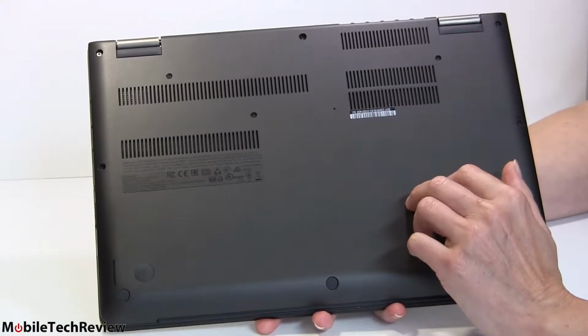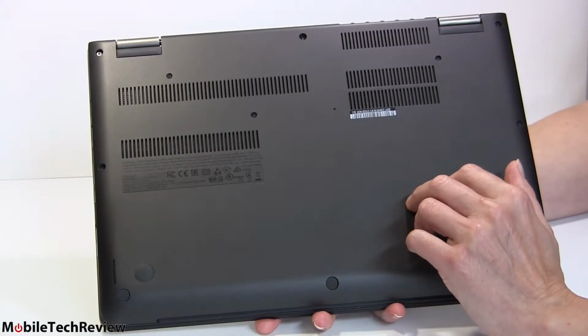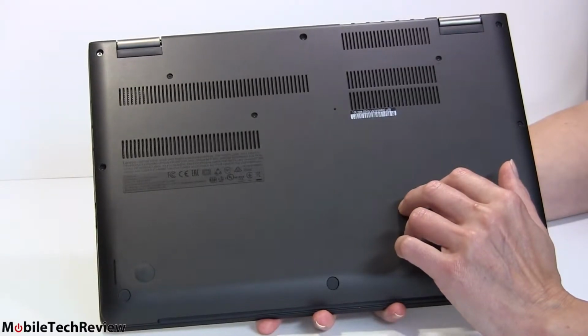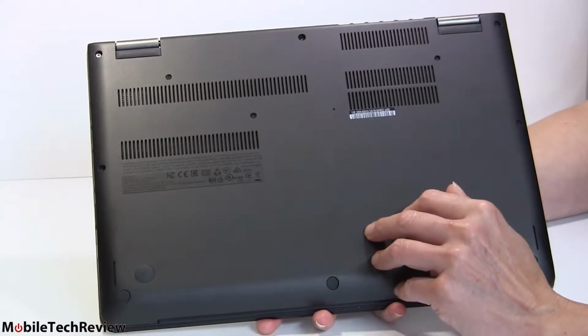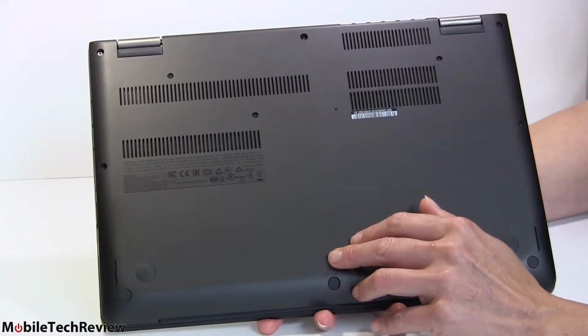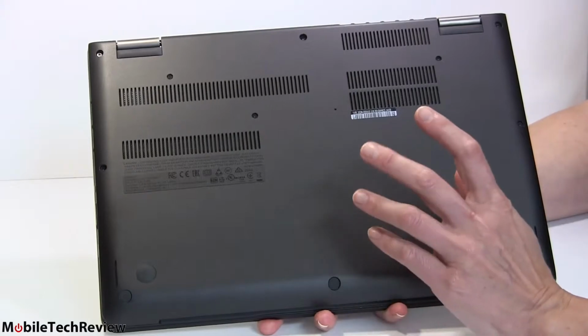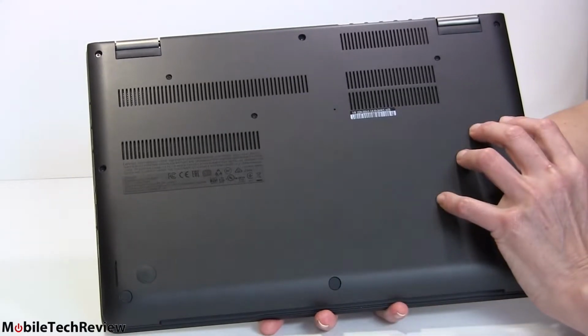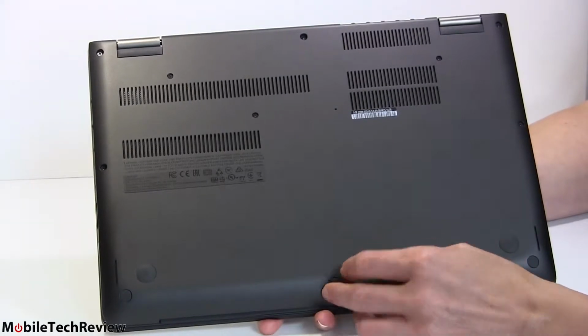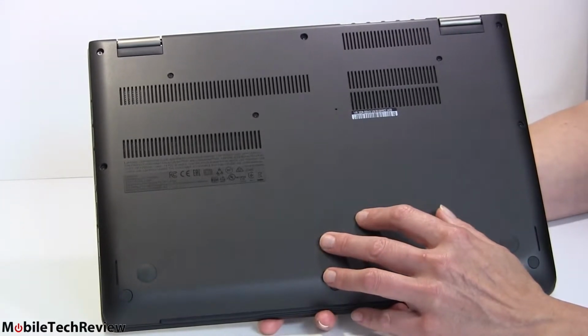This comes with a 1 terabyte 5400 RPM drive at the factory and a 16 gig caching drive, M.2, made by SanDisk on it. So if you're adventurous, I'm sure I know some of you folks do this, you could try putting a big mSATA SSD inside there if you want to keep that big terabyte hard drive. Now, Lenovo always says it's really meant for caching. You know, we don't guarantee it's going to work, but I've heard people do that with other ThinkPads just fine.